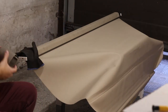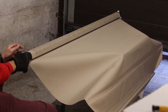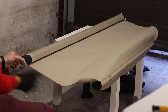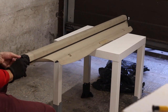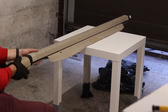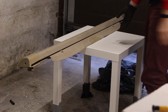You are almost done. Now comes the dangerous part — you have to tension the cover. Put some gloves on and rotate the spring tensioner in the direction of the cover. If you are on the left side, clockwise. If you are on the right side, counterclockwise. Don't do it the other way, because you will ruin the spring inside the load cover. Wear gloves, because if you lose it, it will hit your hand. If it's tense enough, put on the end caps. Don't worry, you can make it more tense later.